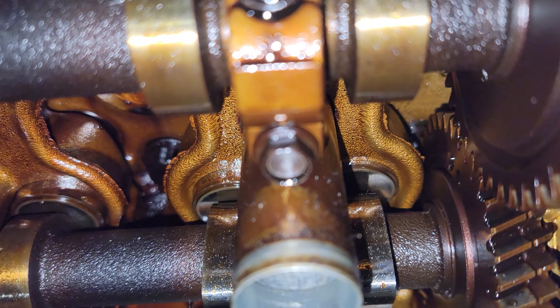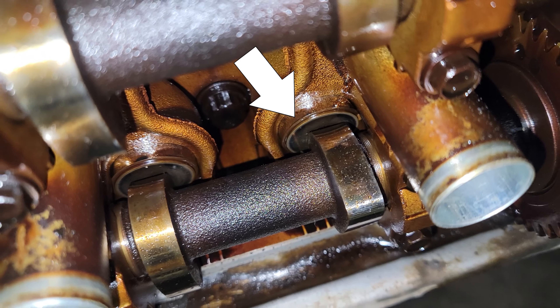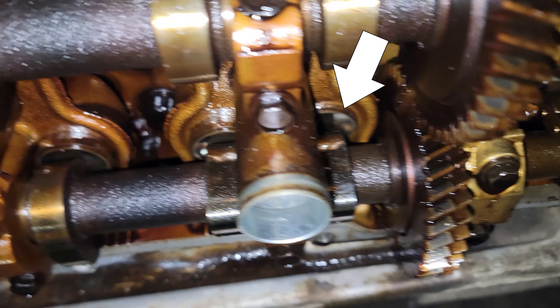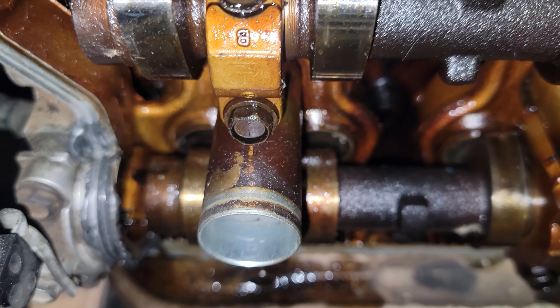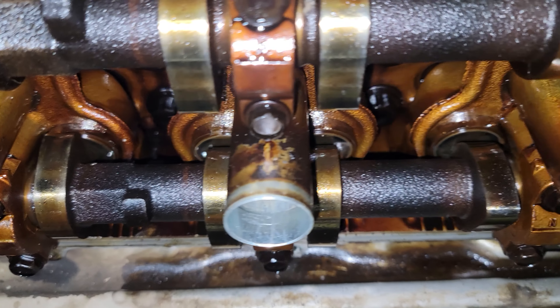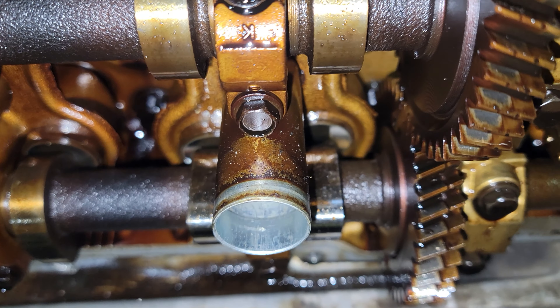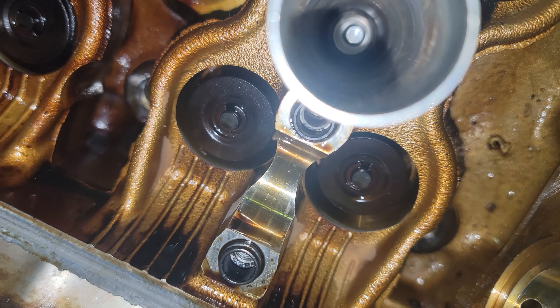You can see down in there — the valve on the left is sticking out, the valve on the right is not. That little silver thing. All of the other ones, you can see both of them for each cylinder are the same. But all of a sudden here, one of these is doing its own thing. So it's now a matter of ripping out the rest of that head — I think I'm ten bolts away from that.